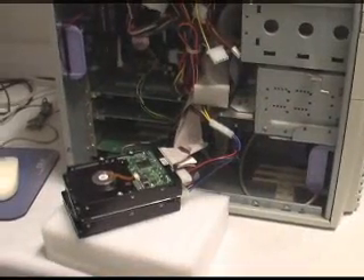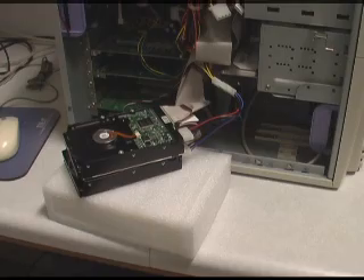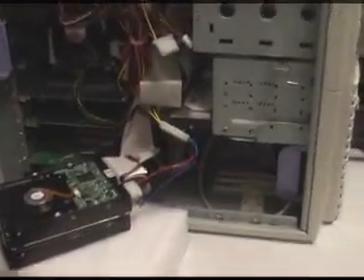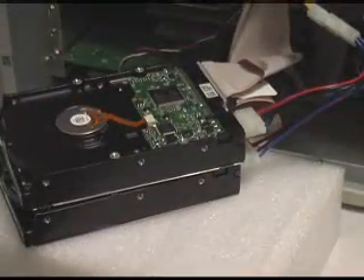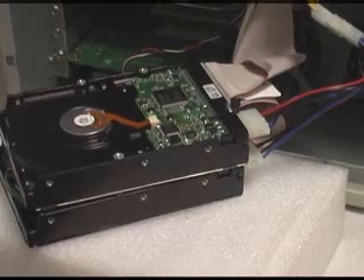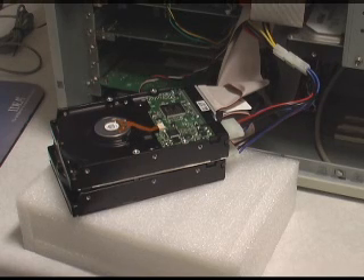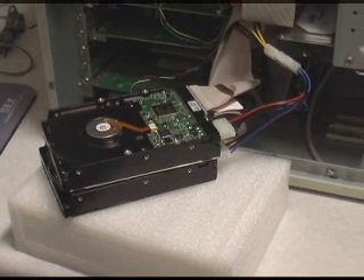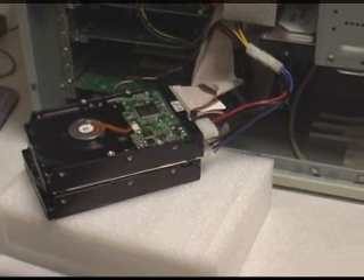Here you see these drives somewhat strategically placed — one of those things, don't do as I do, do as I say. We do have the drives separated, just got a piece of foam for them to sit on. I've disconnected the actual drive that normally runs the computer, so we don't need it. Just need the CD drive and these two drives, new to the machine, cabled together on the same IDE cable. As a caveat, you do not need to jumper them as master and slave if you are using what's called cable select, where the cable is wired in such a way that it tells the drive what to do. There's a separate jumper setting for cable select on each drive. A lot of Dell and Gateway machines will come with cable select implemented. The new serial ATA drives — that's not even a factor anymore, but with the older IDE drives, it is.